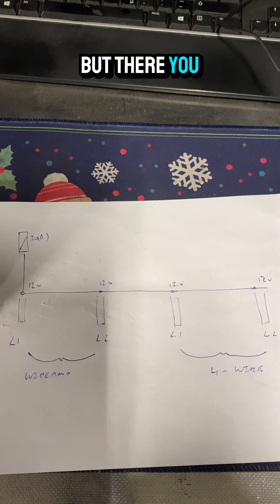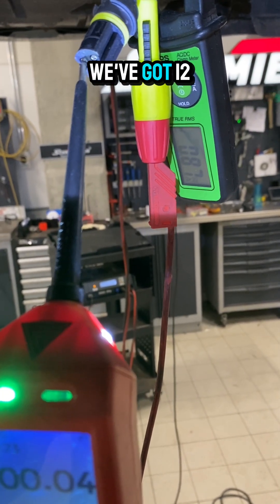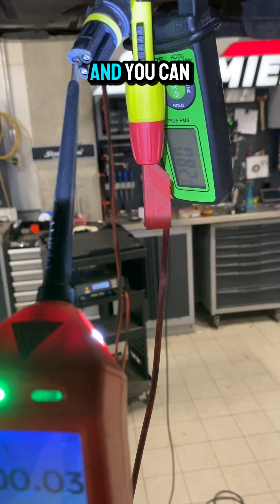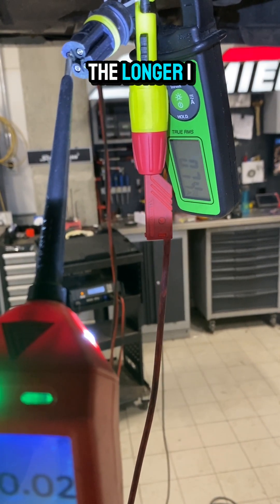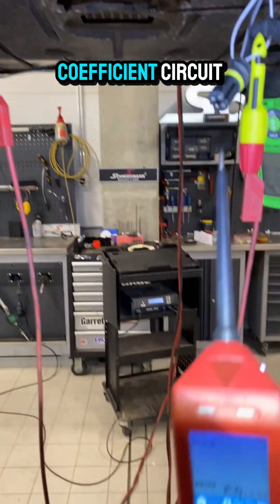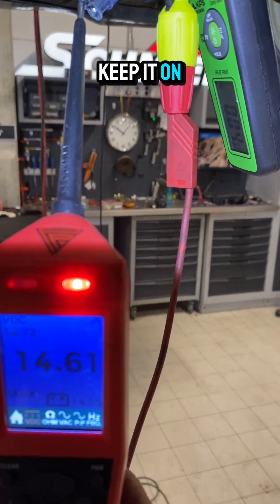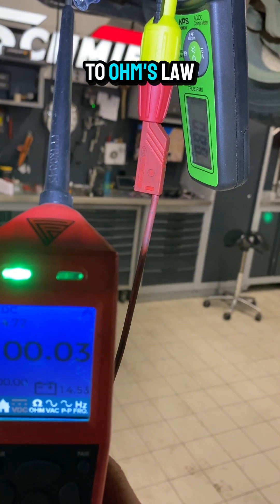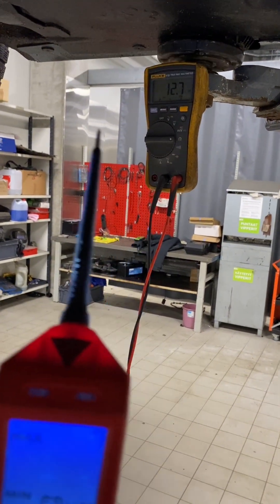Because we can't ground this heater, we've got 12 volts on one set and 12 volts on the other. When we ground it, we're going to heat it up. You can see there's a current draw of 0.8 amps and it's decreasing the longer I hold the ground on it — that's the exact principle of a PTC, positive temperature coefficient circuit. The longer you keep it on, the resistance increases and then the current decreases according to Ohm's law.